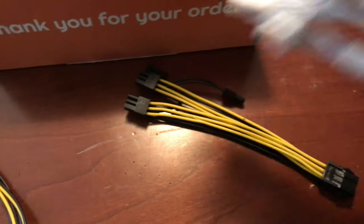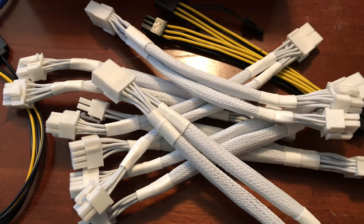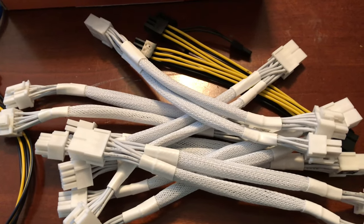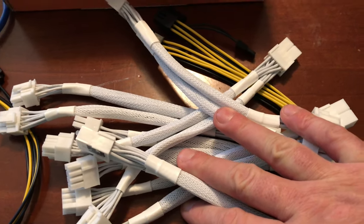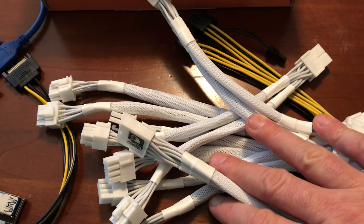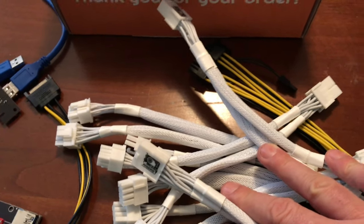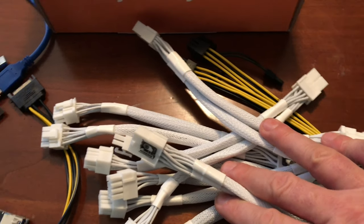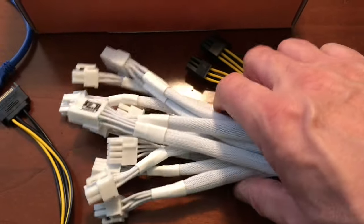I've got six of these to put to work. I'm going to build a new $14 wood rig and stick on some of those AMD RX 6600 GPUs. I'll build the rig first — I already have everything else ready to go, now I have my risers and connectors. I've got enough power from my ATX 750W — that should be enough. Six GPUs at maybe 50W each is 300W, plus the motherboard and CPU gets me close to 80% of 750W, so I'll have to check, it's pushing it.